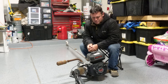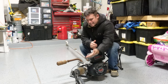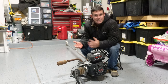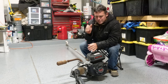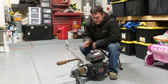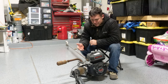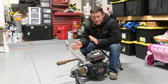This engine is one of the best, most dependable engines you can possibly get. It's got the external gas tank which you can take off. It's got the regular lawnmower-style carburetor, but you can swap in a Mikuni, which is more of a jet ski type carb — it's got a gate valve with needles inside for better throttle response and it can dump way more fuel. But I'll leave the stock carb on because this thing gets amazing gas performance — it's optimized and takes barely anything.